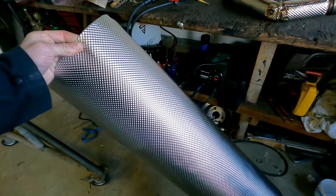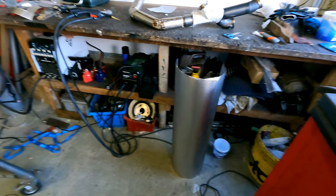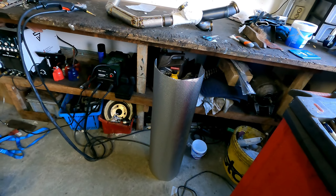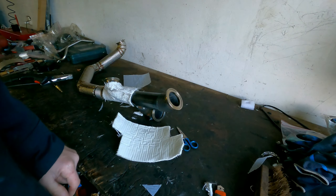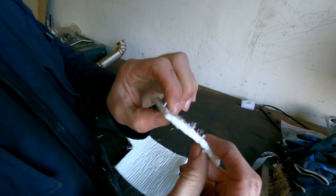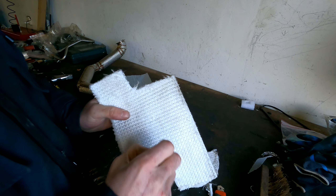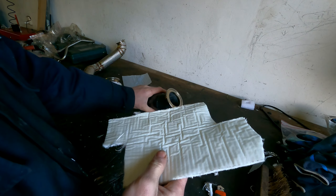If people know where you can buy a little bit thicker material — it's like hammered stainless steel foil — please send me a link, because I searched for a few hours and can only find this. Some people use 0.50 mm but I cannot find where they get it. Anyway, this is the kit you can buy from HJS. I will put a link below to the company selling this in Europe. The ceramic wool is good for around 1200 degrees, so it's good enough for your exhaust temperature.